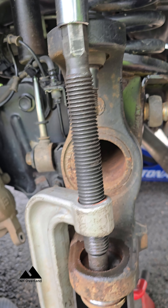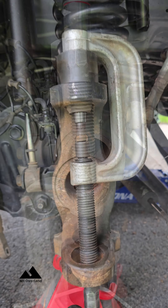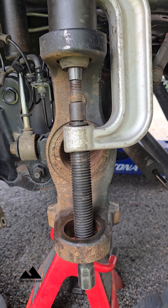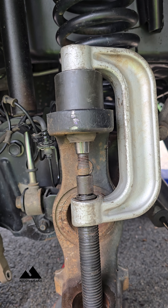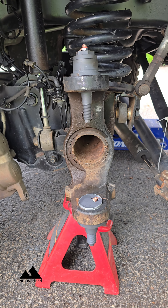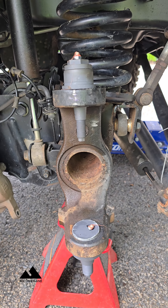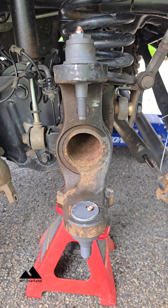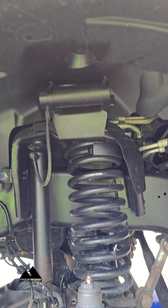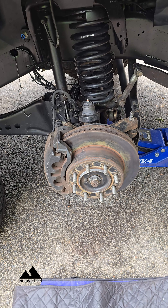The easiest way to do the top is to put the pin right on the jack screw, use a tall enough cup, and let her eat — it slides in no time at all. It's definitely easier to do the top first than the bottom, because you can flip the jack screw inside the C-clamp and work through the bottom hole instead of fighting with the fender up there. Definitely the easiest way to go. Finally, side number two is done and back together.